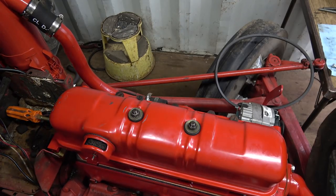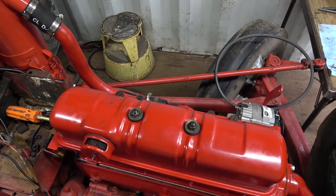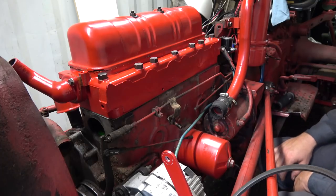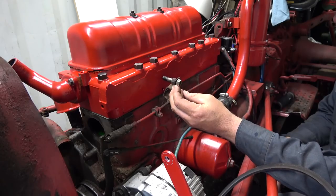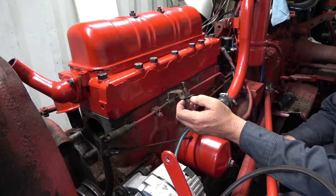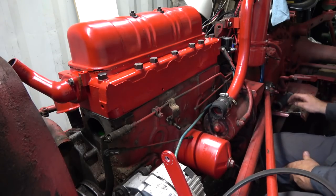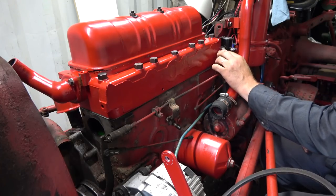Okay, that's on. Let's get the manifold ready to go here too then. Okay, I guess we're ready to open up the manifold here, except I've got one little problem. I didn't get out to get some of these. Well, this one's totally screwed up. I'm going to try to get this stud off of here. I wanted to replace the 7/16 National Fines on there. I never did get to get them, so I won't be screwing this right tight today.